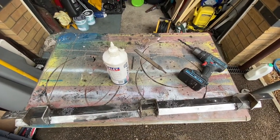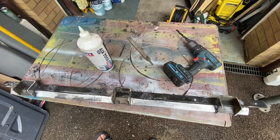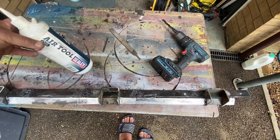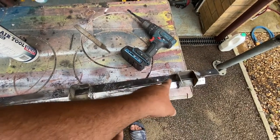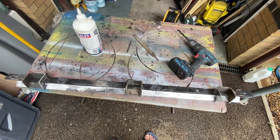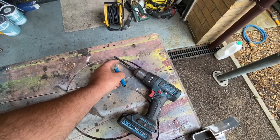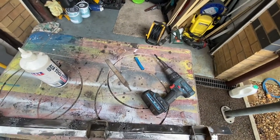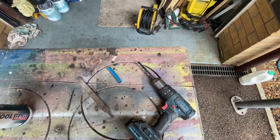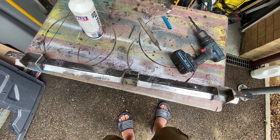Excuse my table — it's an old caravan table I've used as a workbench for many years as you can tell. I'm going through drilling it; it's quite thick steel so I'm oiling it — oil's good for drilling. For the rivnut holes, I slip a bit of pipe over the drill bit so it stops me going through too far and drilling through the side of the van. I think I've got about 100mm to play with, but this gives me about 20mm of safety. That's it — I'll show you when I give it a lick of paint and get it fitted.